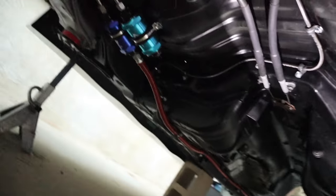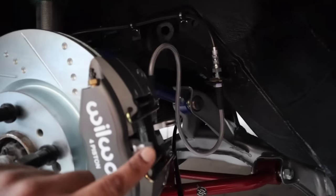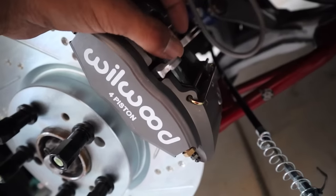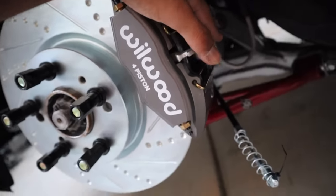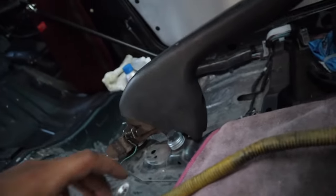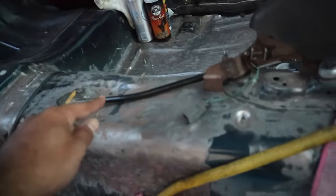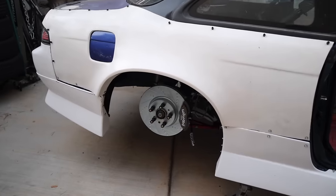They're U'd off like this — I'm gonna zip tie them and hang them up higher so they don't rub on the driveshaft. The next thing you want to do is play with the slack on this and throw this end onto the hook — the spring stays in the middle, and you want to pass the wire through here so that when you pull it, it tightens. Do this to both sides, then come to the e-brake handle where there's a little hole with a nut inside — turn that nut and it tightens the stretch between the lines until you get a desirable lock.